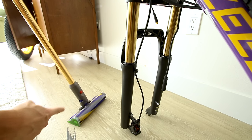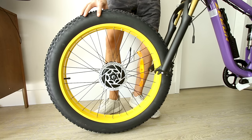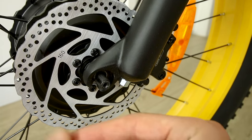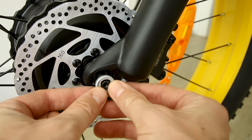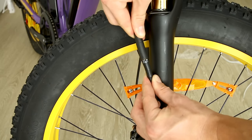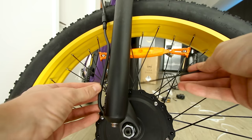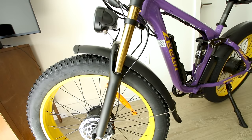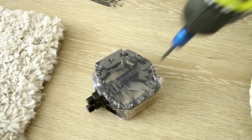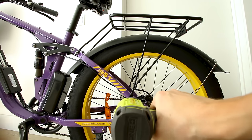Putting the front wheel on is always a little more difficult when there's a motor involved — you'll never see a quick release on a bike with a front motor because you really need to bolt these things down so they don't rotate with all that torque. The zip ties they provide aren't quite long enough to reach, but we've got some extras. Here's what it looks like with the fender on and the headlight mounted. The pedals get kind of close to the front fender — we'll see if there are clearance issues on the ride.